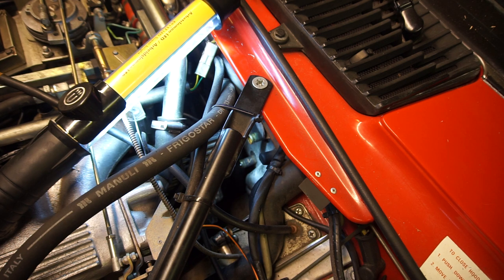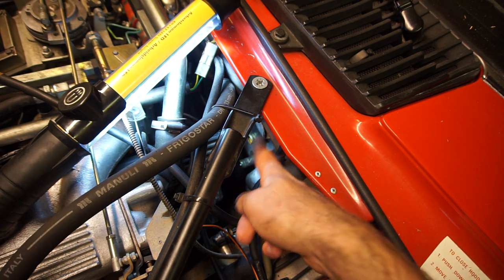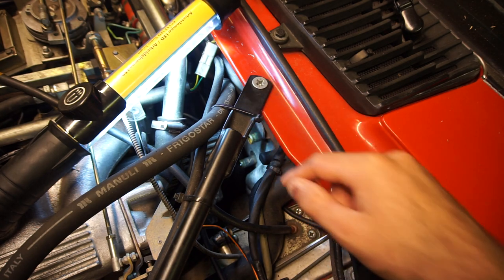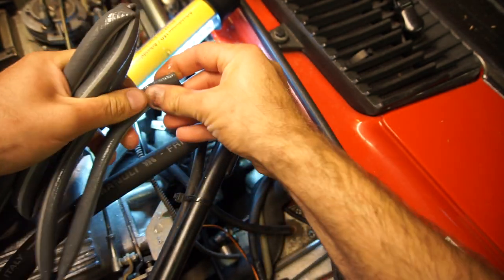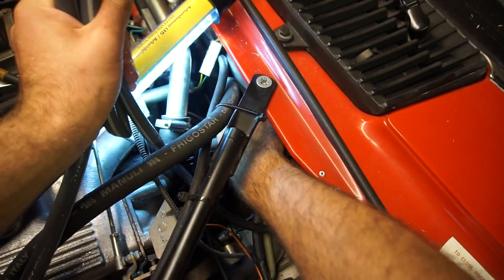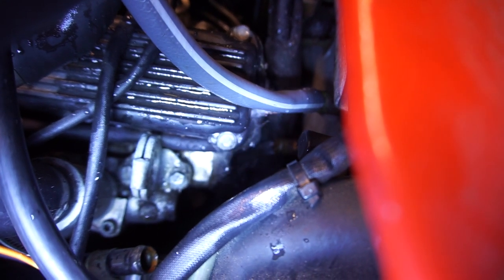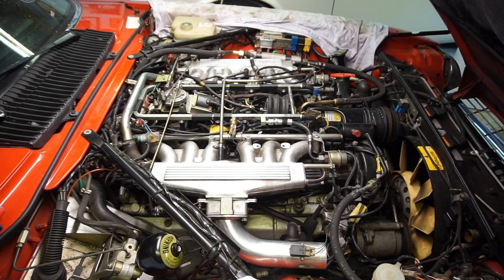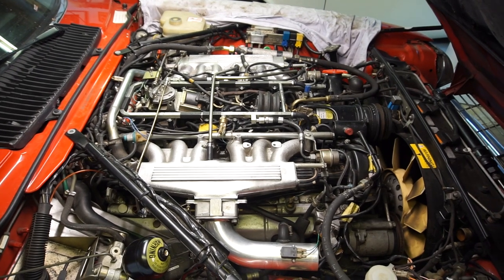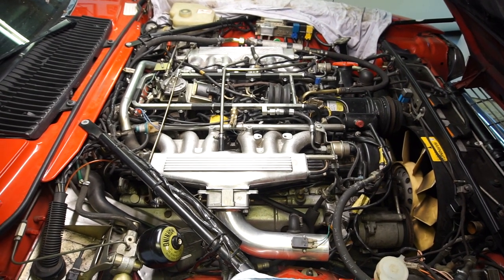Last but not least, I'm going to flush out the heater core. The inlet is at the bottom and the outlet is at the top normally, so I'm going to flush it backwards — from the top to the bottom. I've set up an extra light here so you guys can hopefully see. It's really tight down there and I'm going to try not to get any water on my camera. There's still a little bit of debris coming out there, but it's not bad, and as you can see down there, you can see a nice clear stream of water. So there's no significant dirt or debris in the heater core, which is really good news. The radiator, the block, and the heater core have all been fully flushed, and by the end of it I was only getting nice clear water out. I'm really happy that everything is nice and clean inside.